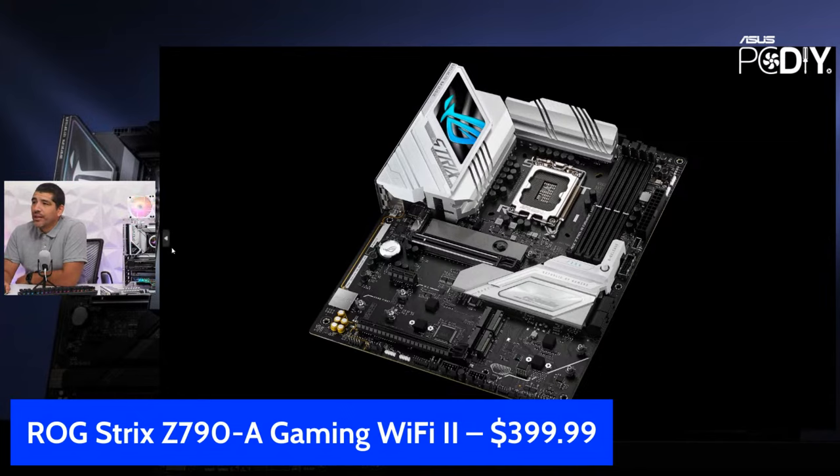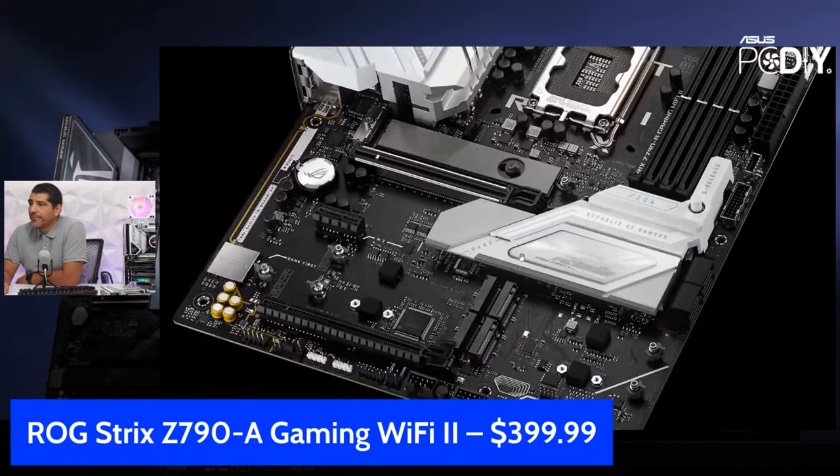Now, one thing I wanted to show right here is, as we remove the heat sinks, another upgrade. When you take a look at the board, traditionally the more entry ROG Strix boards have not had what is referred to as the dual contact M.2 SSD design. That dual contact SSD design is favorable when you have, like I said, larger capacity M.2 SSDs, right, which have NAND on the front and on the back. The Tough Gaming board, all of the slots will pretty much look like this, where you could fit those drives on there, but it's not going to have a dual heatsink design. So this one does have a dual heatsink design for that primary PCIe NVMe M.2 SSD slot.